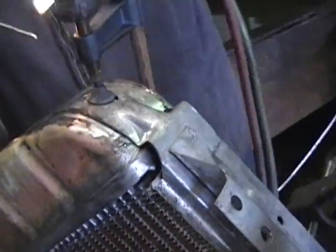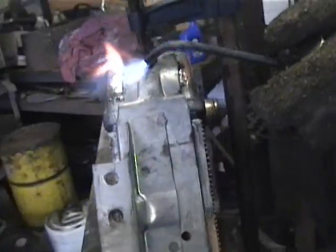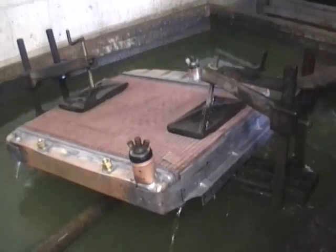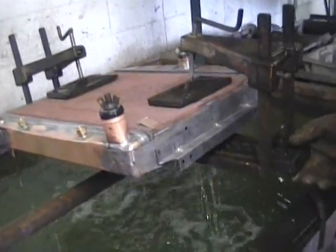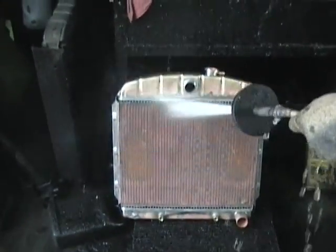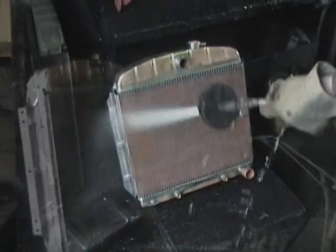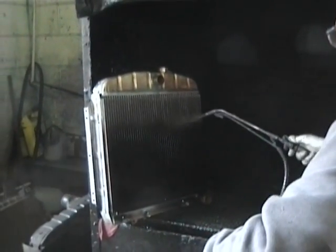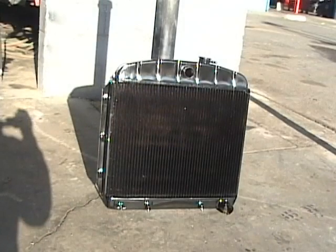The brackets and the straps are the last to be attached. The finished radiator is now ready to be pressure tested. We test to 18 pounds of pressure to make sure your radiator will not leak. The radiator is rinsed off and set aside to dry. We give our radiators two coats of paint to prevent corrosion of the copper core. The tank and side straps are painted with a hard coat of black to prevent fingerprints and scratching. Our radiator is finished and ready to install.